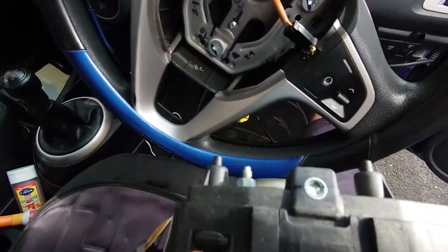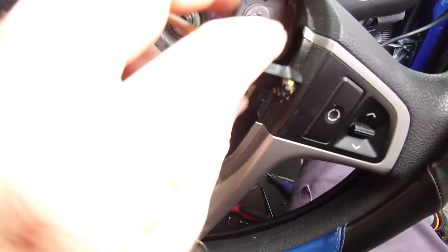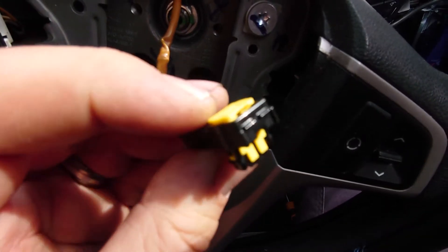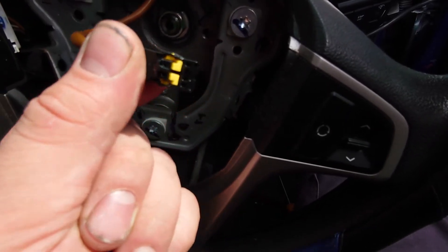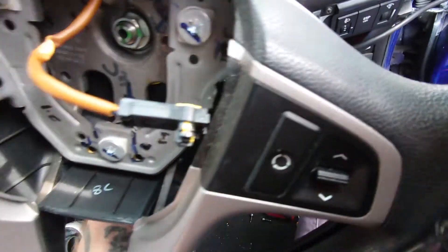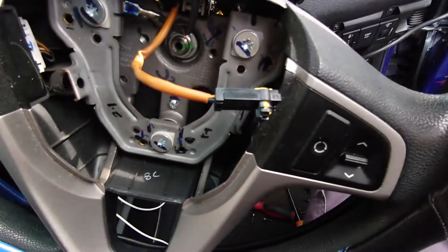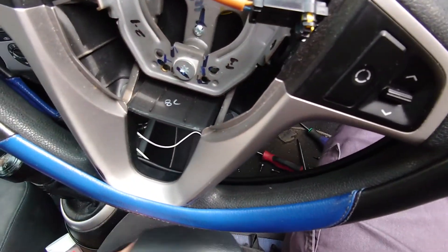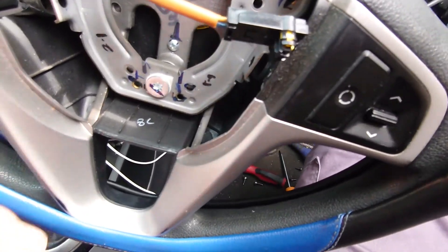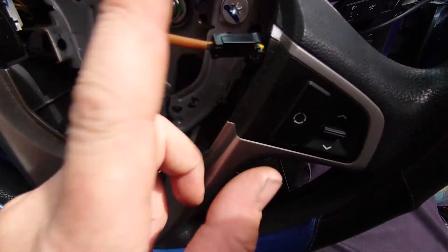Airbag is out. There's a screw either side, accessed through a couple of holes, and the same on the other side — it's a T40 screw. Connector comes off as usual: pop the little yellow bit up with a little screwdriver and then pull it out. So if we do a resistance measurement between here and underneath on the back of the column, we'll see if we have high resistance or an open circuit on these wires. Personally, I have never had to change an airbag — ever — so very doubtful there's any issue with that. We'll get a meter out and test this.